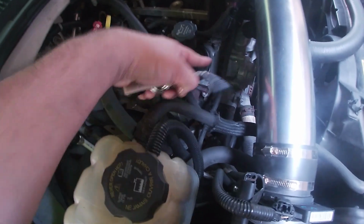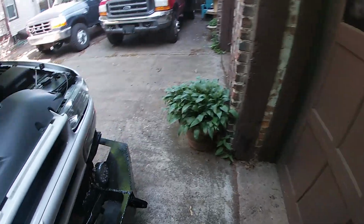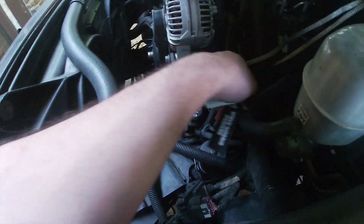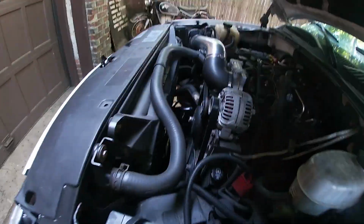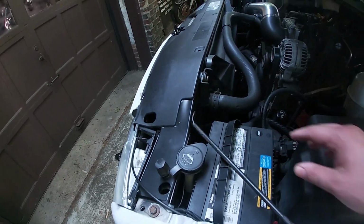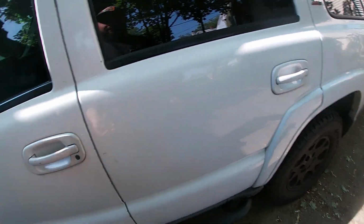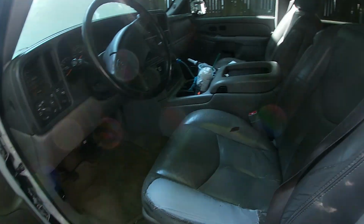Maybe we'll change the exhaust manifold that's been going. I'm gonna run a ground wire from the battery to the chassis. I gotta redo that. I wasn't really thinking what I was doing when I did it. This alternator's having a hard time. This battery seems fine. Cheapest battery I could find. It's $50 with a $12 core charge, and I have junk batteries, so not bad.